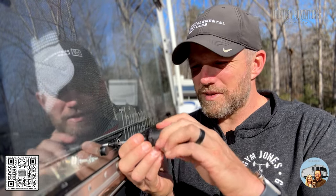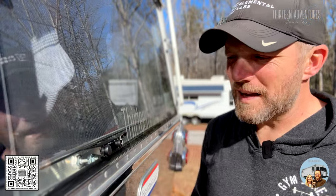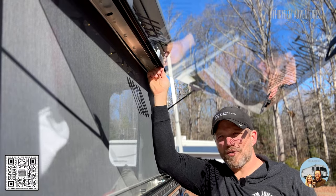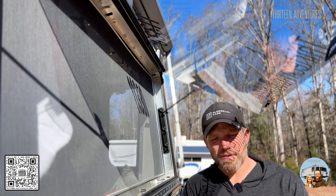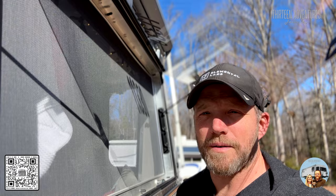The screws will spin in position, so you're going to have to open the window up and hold on the back side. That's something you can check to make sure it's not leaking and that it's tight. If these things ever rip off, you can replace them. One easy way to check: if you can grab it and turn it with just your fingers, it's probably too loose. If you need to tighten it, grab a small set of pliers — screw on one side, pliers on the other. I hope this helps for any of you who may think you have a leak in your rig, but it might just be the window.